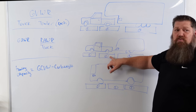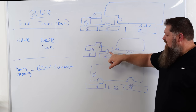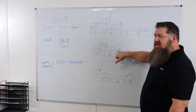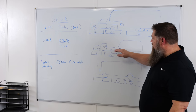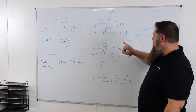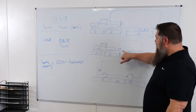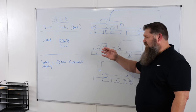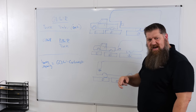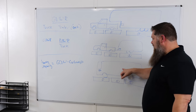If you're under your GVWR but your rear axle rating is a little heavy, this is where you'd use weight distribution adjusters to push some of the weight to the front axles. If it's nose heavy, you can take weight from cargo and move it behind the axles, or use stabilizers to push the weight forward to the front axles.